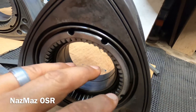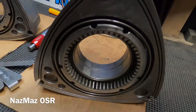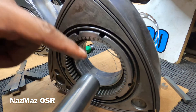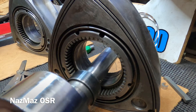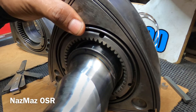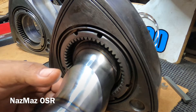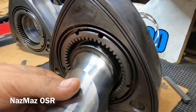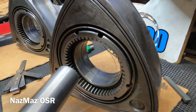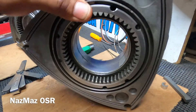Get your center shaft and just make sure it goes in and out easily. So I've got the eccentric shaft here and the bearing is already lubed up so it won't get scratched. You can see how it goes in and turns really smoothly — it's not binding. That's what you want to see. It's a quick and efficient way to check, and obviously there's no signs of wear, meaning no copper showing.